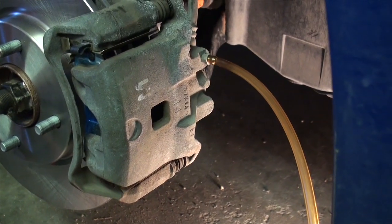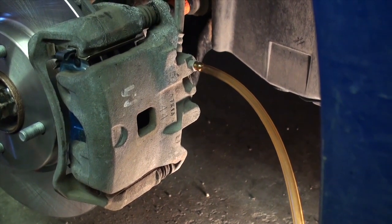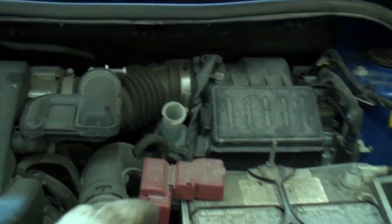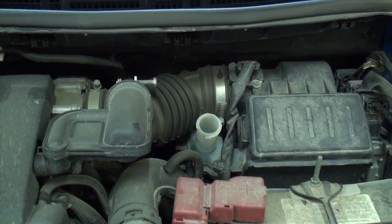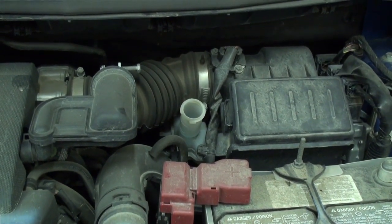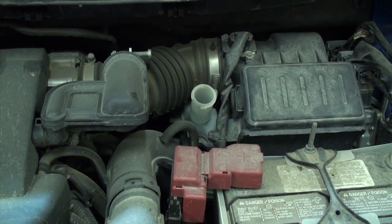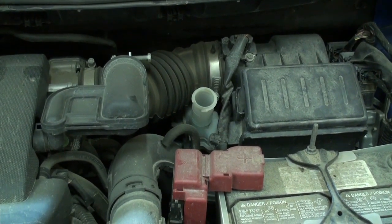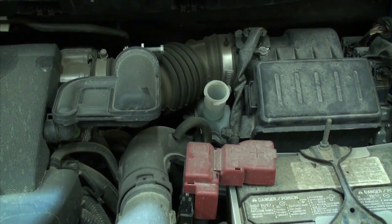In my particular case, we're going to do a brake fluid flush. Basically, I'm going to take a fresh batch of brake fluid and run it through my master cylinder filler hole, which is located right up here beside the air cleaner, and just keep pushing through clean fluid until the fluid coming out of that tube is the same color as the new fluid I'm installing. I'm going to show how to do one of the fronts, and servicing the other side is exactly the same. Bleeding the rear brakes will be symmetrical on the rear end of the vehicle.